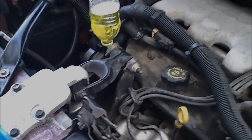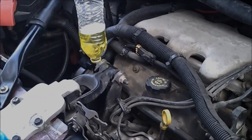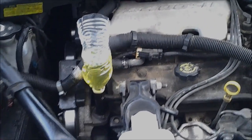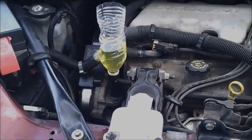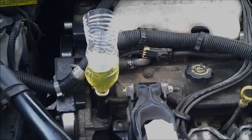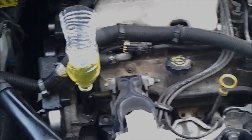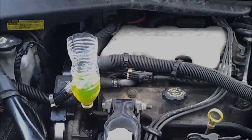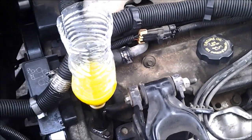I'm going to go start the engine up and we'll see it bubble up here a little bit. I'm just going to turn the starter a little bit to get the belt pumping the pump. You can see that the level went lower — now we can squeeze more out. We're just circulating out the air, and we can watch the bubbles forming. We're going to do that a few times until we get no more bubbles coming up. It's almost like CPR on an engine to get the bubbles flowing out. You just keep going until you've got no more bubbles.